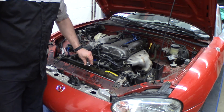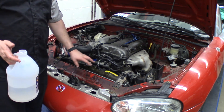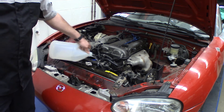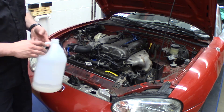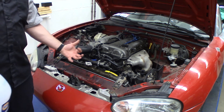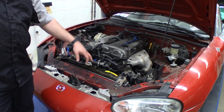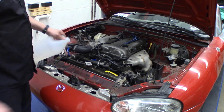Now we can wash the tester down and put it back. Take the coolant that came out and pour it back in, then put the radiator cap back on nice and tight. We had a little coolant spill from testing, so pour some water on top to wash it down. Coolant is not good to drink — it's bad for you, it could kill you — but diluting a small spill with water reduces it to basically nothing. If you're doing a full coolant change and capturing coolant, that needs to be taken in for recycling so it doesn't get into the water supply, but small spills like this can be diluted out with extra water.